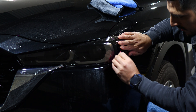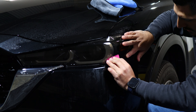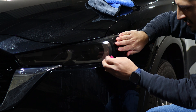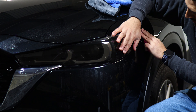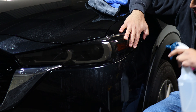Now that we have this piece secured, we're able to stretch the film in order to remove the fingers that you see here. When stretching, stretch this way as well as going up, because we need to align it here and up here too. Make sure you stretch and remove the fingers. Then apply tack solution that way we start helping the adhesive tack down.